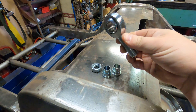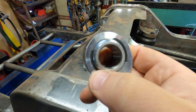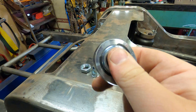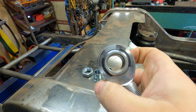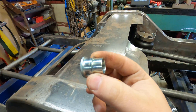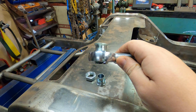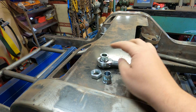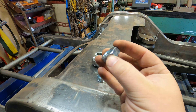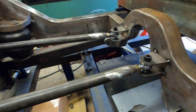Next up we just have a heim joint — exactly the same as what we've just put in those links. These ones in here are PTFE, which is like a Teflon nylon-raced heim. One thing to consider is you can get spacers for them — these are misalignment spacers — but they allow more articulation to the bolt; you do step down a bolt size with those. And these are the jam nuts I spoke about before — just like a half nut.